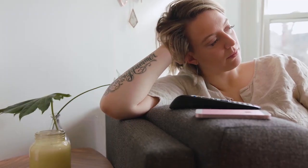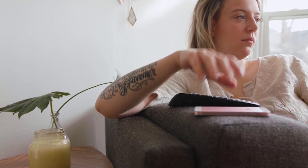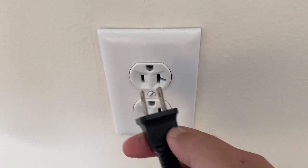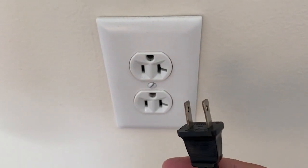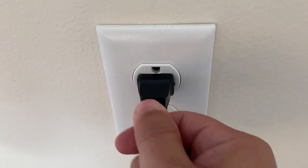I'm going to show you a few really simple ways to try and solve your problem and get you back up and running again. The first one is the easiest one to try, and that's to unplug your TV from the wall outlet and wait 60 seconds. Don't be impatient here — wait the whole 60 seconds, then plug it back in.